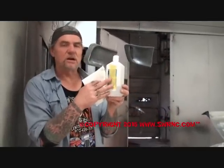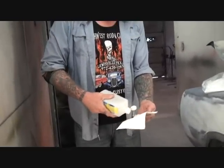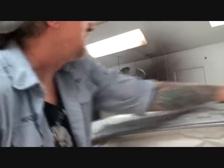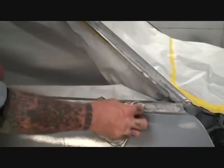So what we're going to do is take rubbing alcohol — or you can use denatured alcohol, whichever. Go ahead and saturate your rag with it. When I say rag, I'm talking about a lint-free, tack-free white cloth specifically made for paint use only. We buy these cloths at the automotive paint store. What you want to do is just basically wipe it off. You're going to wipe the Bondo because that is where we're really counting on getting it clean — getting all the dust and grease and slime off. Look at that black stuff that was right there — I just got it off.